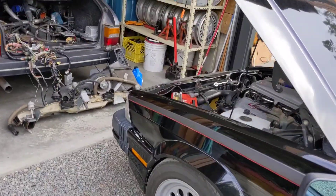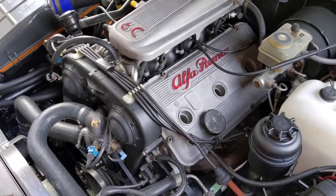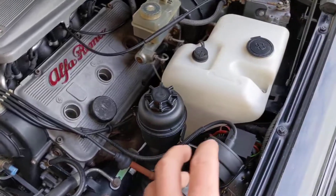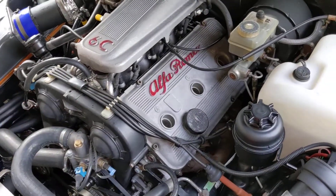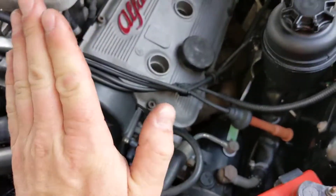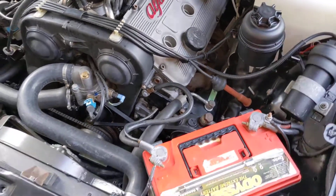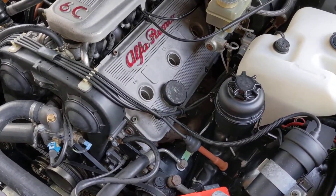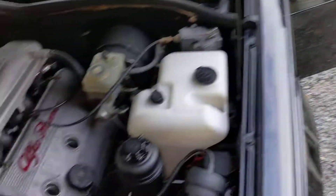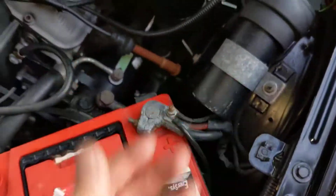This engine is going to be fairly hard on ignition components because it has a higher compression ratio. I'm running a lot of timing on it, which means there's even more cylinder pressure, which makes the coil work harder and places more stress on everything else in the system. I'm getting the misfire basically when I accelerate sharply between 2,000 and 2,500 RPM, which says to me there's an issue probably with one of those basic ignition components. I haven't done anything with the coil or anything yet, but we'll do the cheap stuff first — and the coil is cheap too.